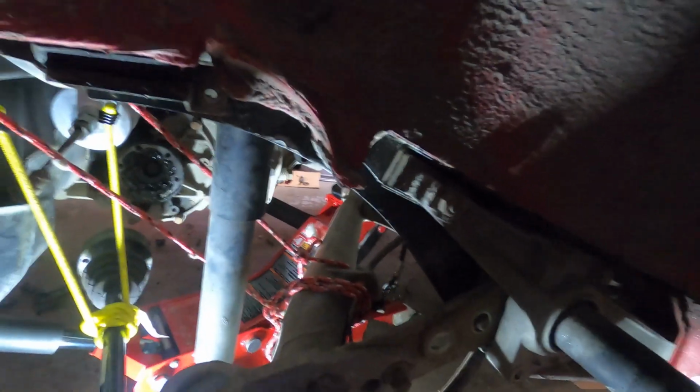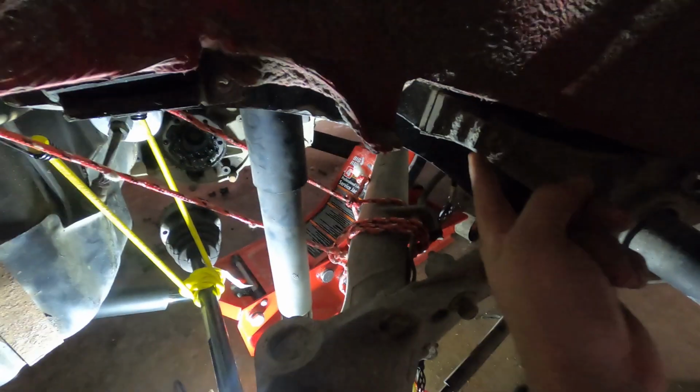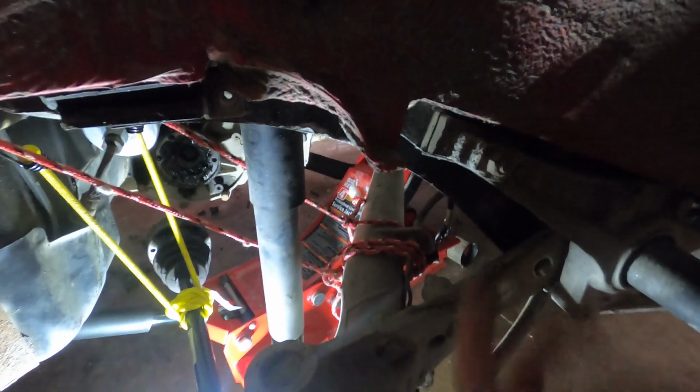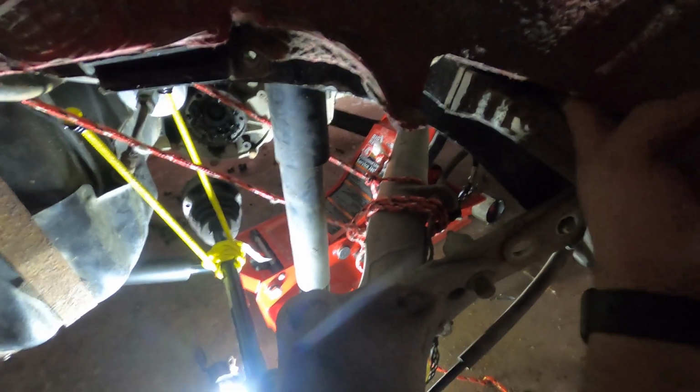Okay, so again in the DIY, one thing they didn't cover, so you definitely have to pull this bolt because this entire assembly comes down. They don't talk about pulling this bolt, which I don't know exactly how the access to the back of that bolt works. Anyway, it's not in the diagrams, and the diagrams aren't accurate. So what I ended up doing was pulling those 2 17mm bolts. They're kind of a pain in the ass to get to, but it's letting this whole unit kind of start to pivot down. Once I started to pry, the entire thing started to move.